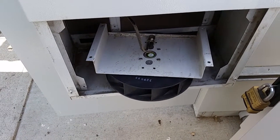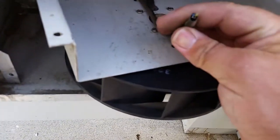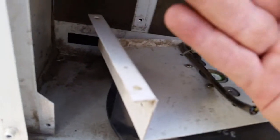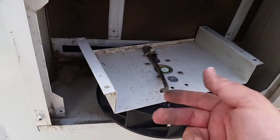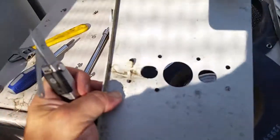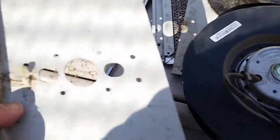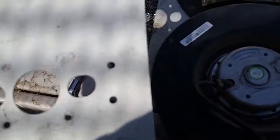I'll do a quick shot so you can see — I cut the sheathing back and it's just four wires. You take the four wires from the new fan and butt splice them together with that. Then remove the bracket from the fan with those four screws, and cut the tie wrap.